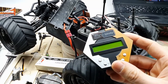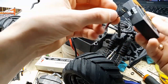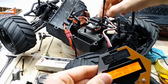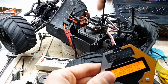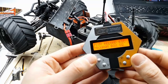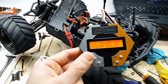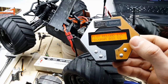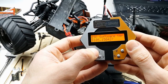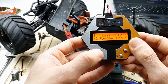First things first — if you don't want to update the firmware you don't have to connect to the PC. You just take this cable, plug it into the program box and into your ESC, replacing the connector that's normally there. Turn on your truck and you can see what options are available to change.